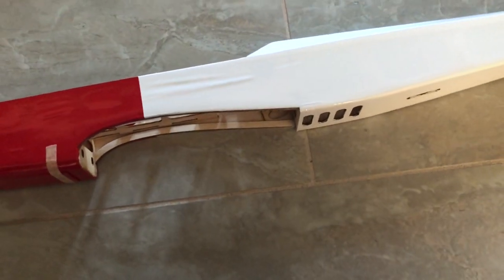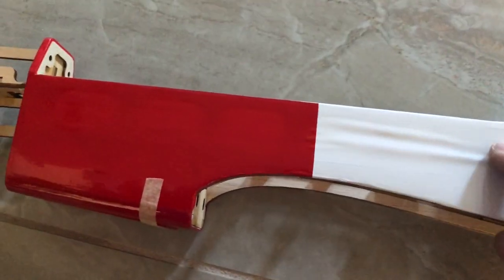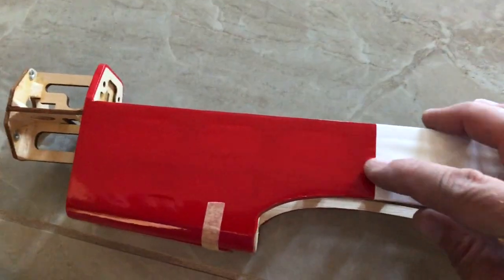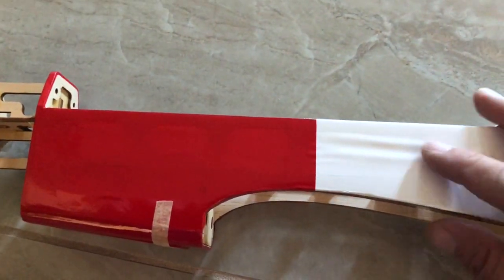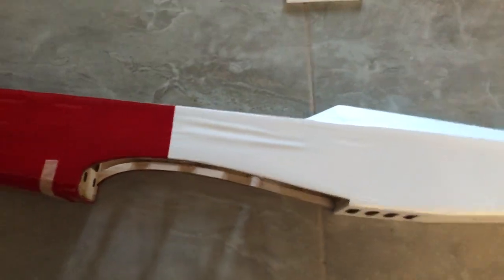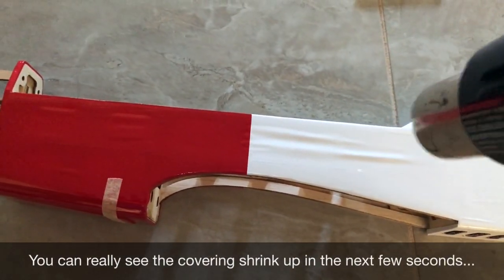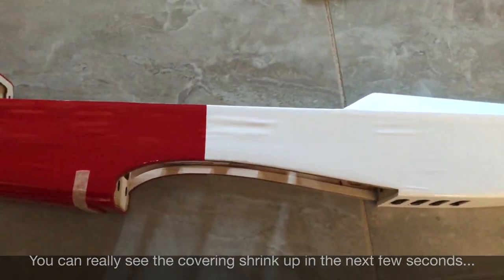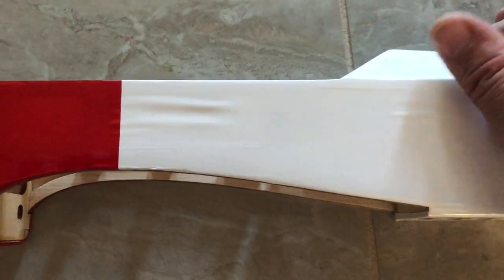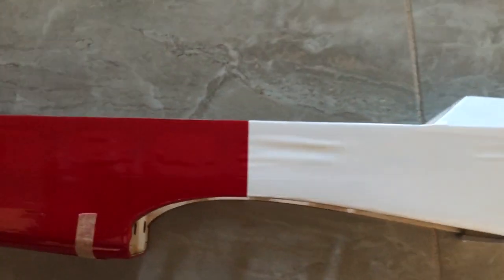Taking it away - let's see what happens. That did not cure the problem here, so this wrinkle is still here. I'll check if the material is stuck anywhere - it doesn't look like it, it's open air underneath. So I'll try to shrink it some more, keeping the heat on low. There we go - look at that! Just a little work and that's how you get the wrinkles out. A little more over here still needs to be done.